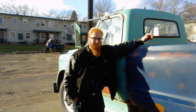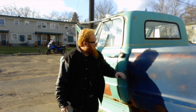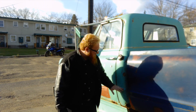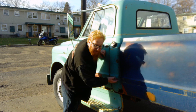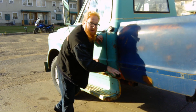Hi YouTube, Roy Marco with Roy Marco's Garage. Today, the C50 truck box. I'm going to show you what I did — the process of lifting this box up and what I had to do. One of the things I needed to determine was the height. In this video you'll see there was about a five inch difference between where the cab line was and where the box line was when the box was sitting directly on the chassis.